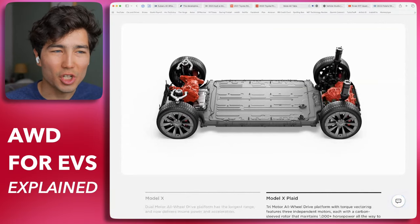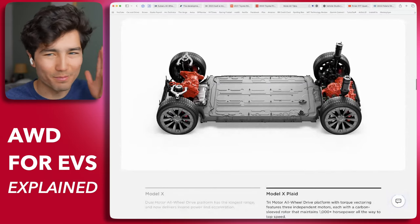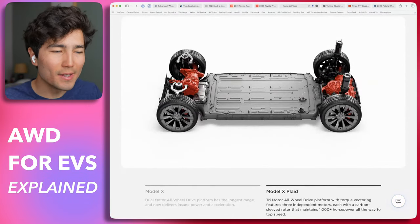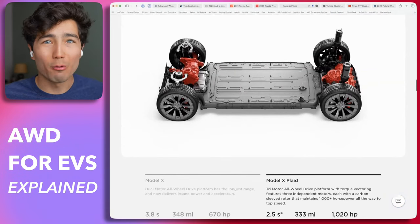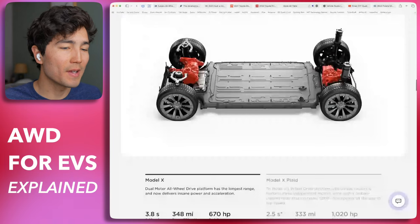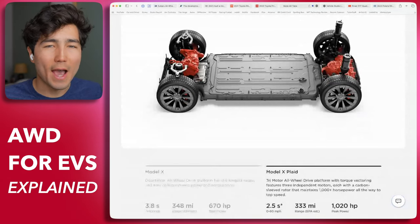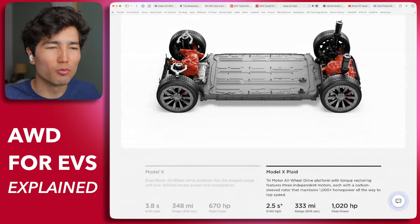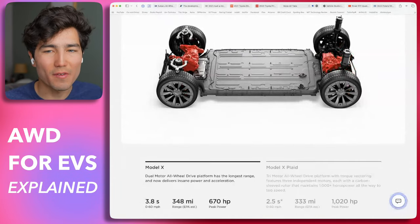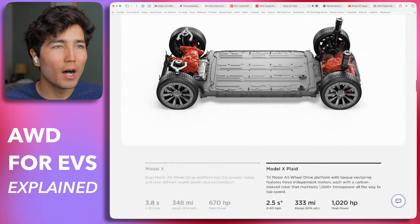With the Plaid, the rear axle looks different — there are actually two motors, symmetrical, one on each end of the rear axle. So it's essentially one motor per rear wheel. This allows Tesla to do several cool things. First, it's simply more power — more motors means a lot of power, especially in the rear, plus a beefier front motor. Second, because each rear motor controls its own wheel, they can do torque vectoring — driving one wheel harder than the other for really good performance in turns and on track.